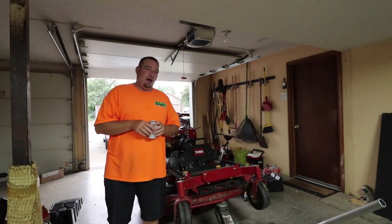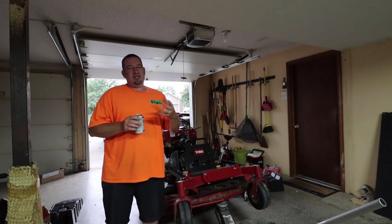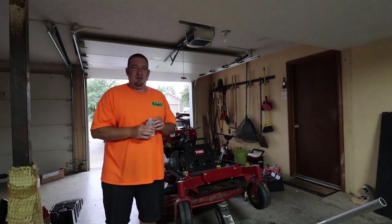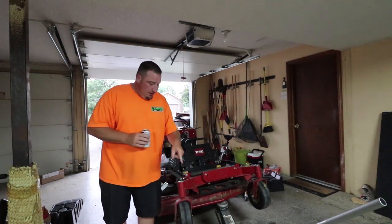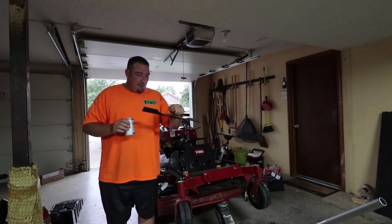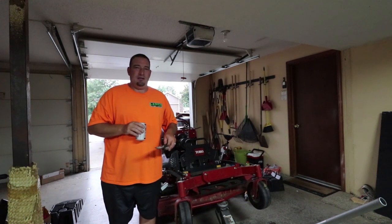What's going on guys? Danny with Lanier Line Carrier. Today I'm going to go over just a quick thing of me cleaning out from under my decks. This is pretty much an every day or every two day thing that I personally do. Make sure out from underneath your deck is clean — it's going to give you the suction you need to make sure you're cutting the grass at its full potential to make it look beautiful. Another thing we're going to go over is what blade sharpener I use to sharpen my blades. So let's get going.